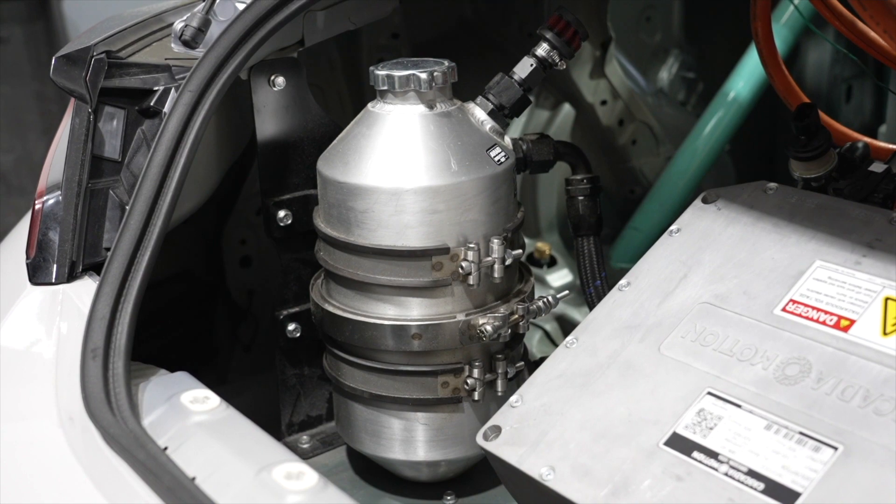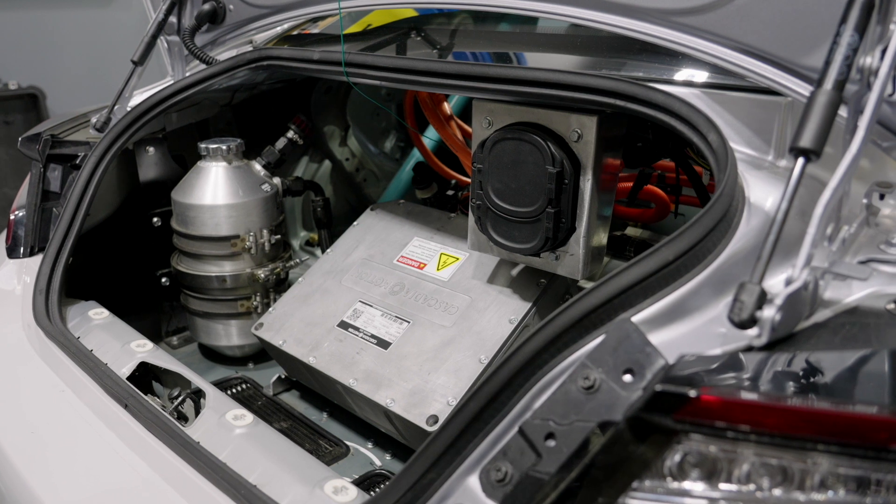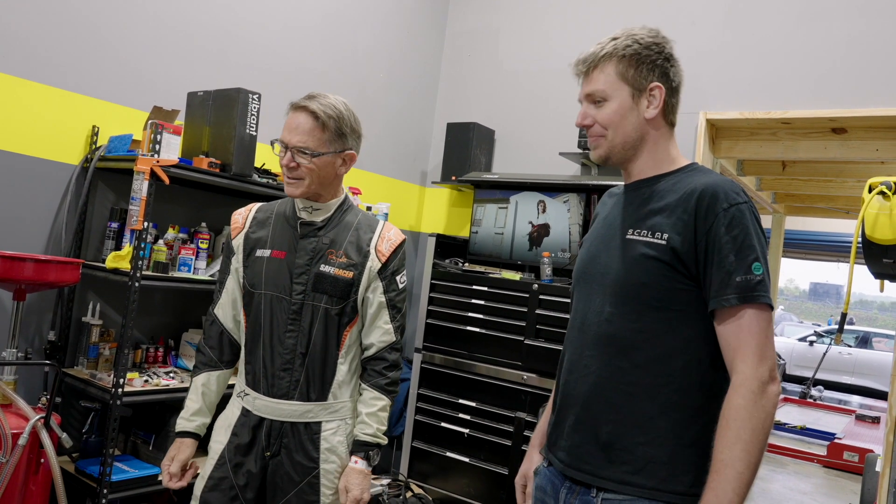It's a rear-wheel-drive car. The motor is right there, bolted straight down to the subframe, driving the rear wheels through a gear reduction box that picks up the Torsen limited-slip differential and drives the axles just as it would in the GR86. The big box there is the inverter — it takes the DC power and converts it to AC power to run the motor. That dry sump tank provides cooling and lubrication for the motor. The motor is capable of 500 horsepower, and right now we're finding the right balance of power delivery and runtime. It weighs about 80 pounds.